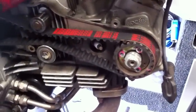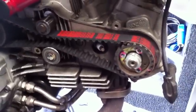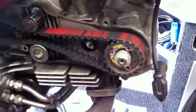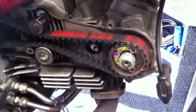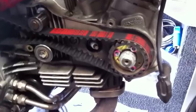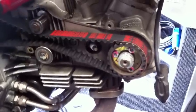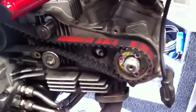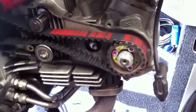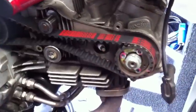It should be between 105 and 115 hertz. You must make sure, however, that the cylinder you're adjusting is at top dead centre. So you'll need to turn the engine from the position we've got it now — top dead centre on the front — turn it 90 degrees to get top dead centre on the rear cylinder. This is because there are actually some valve springs in there that hold the valves shut while the engine's starting, because the desmodromic valve gear on its own has some clearance in the valves and the valves would actually leak when you were trying to start it. So this isn't a full how-to, but hopefully that gives you a bit of an idea of what goes on.